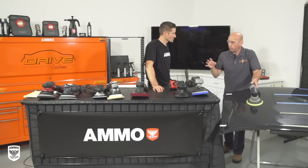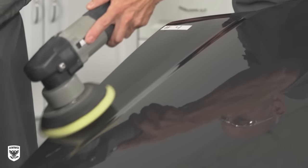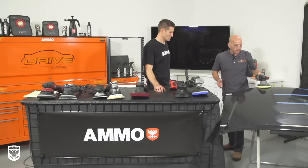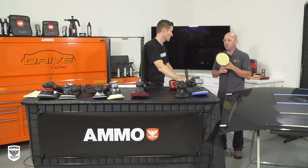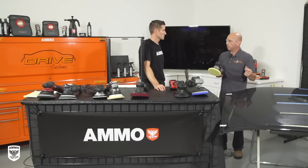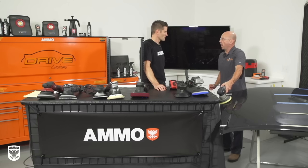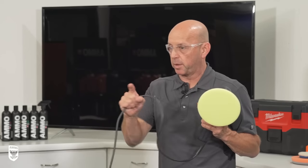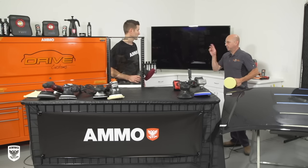The random orbital has lower torque and lower power motors. Get on an edge and it's still smooth — right off the edge, still smooth. You can bump speed up and still do everything you do with a rotary. You can tilt a little, but there's still a capability of removing a tremendous amount of paint rapidly. By and large, you have a little more time to adjust and get yourself out of trouble versus the rotary, which would dig in and grab immediately.